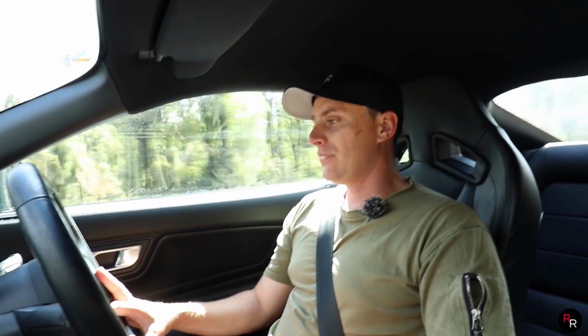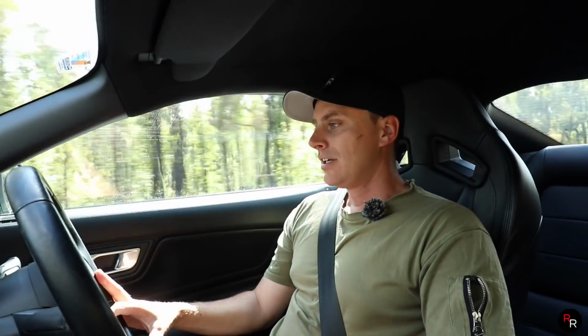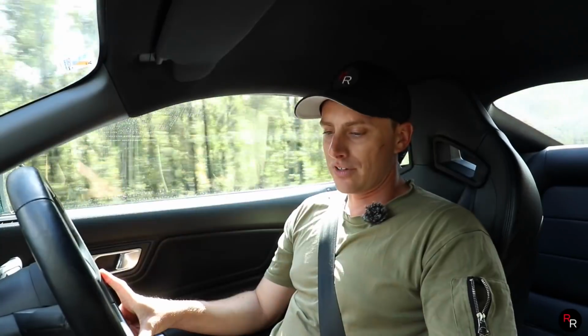Yeah, it seems to really be bogging out when I release the clutch. I've tried slowly releasing. I've tried dumping the clutch. And 6.5 seconds is the best I could get. But even then, we did have a significant kind of lag. So we shouldn't have any lag. This is a naturally aspirated engine, so there definitely is a trick I am missing. Leave it in the comments if you know what I'm doing wrong.